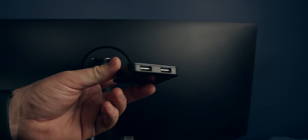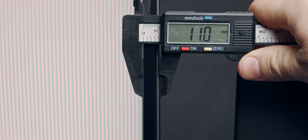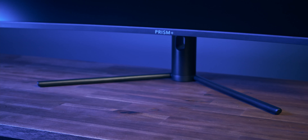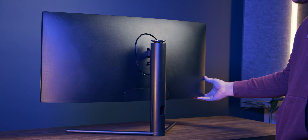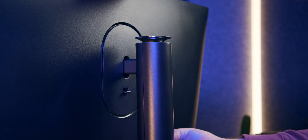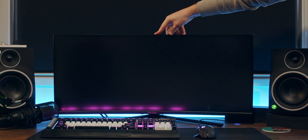You can plug speakers or headphones into the monitor if it's set as your audio output device. Since there is no USB pass-through, I typically just gaffer-tape a hub to the back — no real big deal, and this will probably keep those costs down. There's a bezel thickness of 11mm on the sides and just under 10mm on top. The stand is sturdy — those cold-to-touch solid metal rod feet are awesome. You've got 15 degrees of horizontal swivel, positive 5 and negative 15 degrees of tilt, and 100mm of vertical lift. The choice of plastics is quite nice, quite durable feeling, and I don't think it's going to scratch easily.